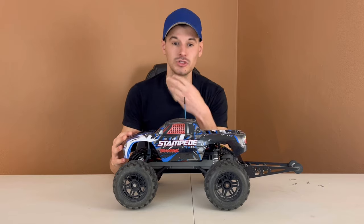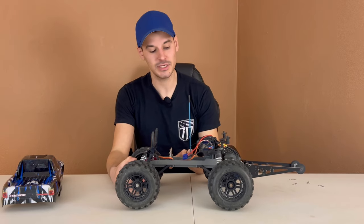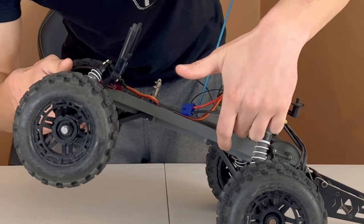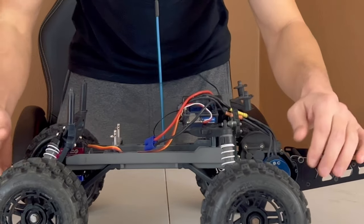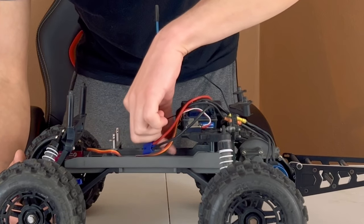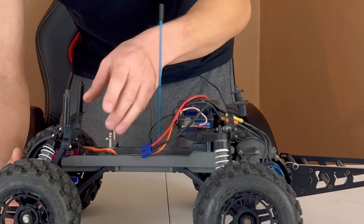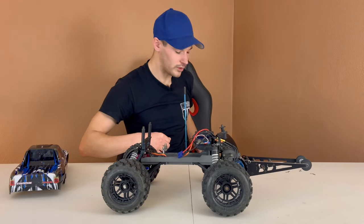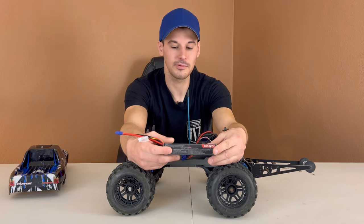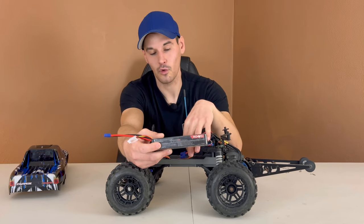Number three is the battery tray. The issue is that stock it only has enough room to hold a two-cell pack. What I'm running now has something called the battery expansion kit — a Traxxas upgrade part — which basically lifts up the ESC and receiver box platform so you can fit a larger battery underneath. It also includes longer posts that screw into each side to hold a taller battery, because stock this thing can only hold a battery that's roughly this tall. I'm not 100% sure — let me know in the comments — does the VXL model have the same layout or does it have more space for a taller battery?